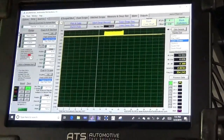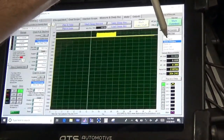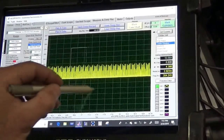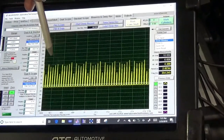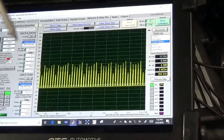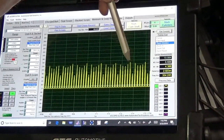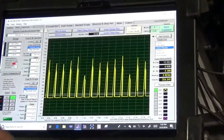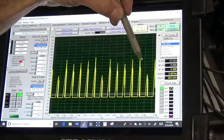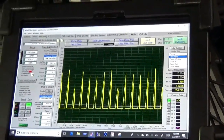I'm going to stop recording data. Our buffer has captured some amperage data through the ignition coils. I'm going to zoom in to get a better look. What we can see right away is a repetitive pattern — we've got all six ignition coil ramps captured at one time, and the process repeats itself for every engine cycle. Every sixth ignition coil ramp is a ramp that's significantly lower than the rest. This fault is happening over and over again as we pan through this capture. We're going to have to attach a second channel to identify which cylinder is at fault.